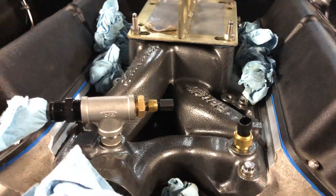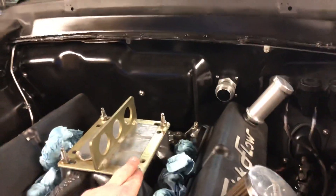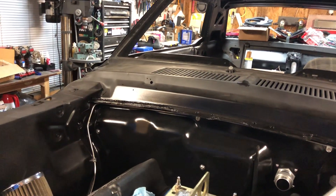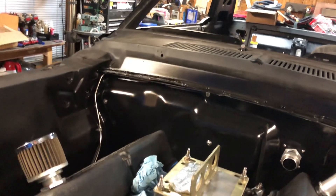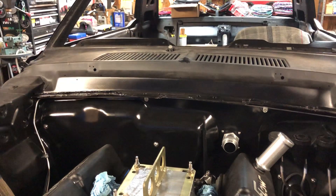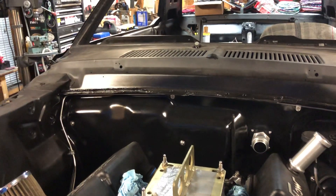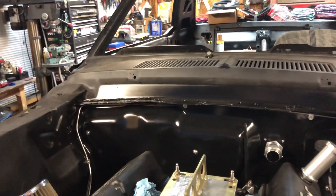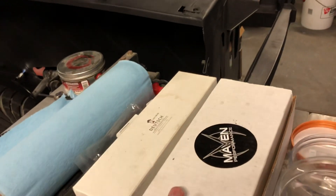They have oil pressure safety switches that screw into an NPT port, but I have a stepper motor oil pressure sender. I'm going to splice my signal wire, feed it to one of the Holley's inputs, and it'll work as an ignition kill safety. You can also set it up to kill the fuel pump if you're getting fuel-starved, or monitor injector duty cycle — if the duty cycle is too high meaning the injectors are basically wide open because the engine isn't getting enough fuel, it'll kill spark to prevent a lean situation. More of an issue with boosted applications.